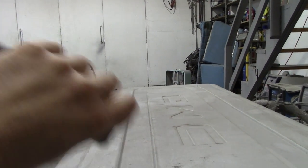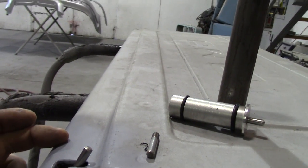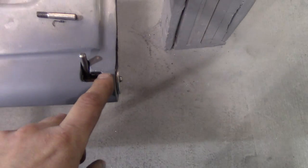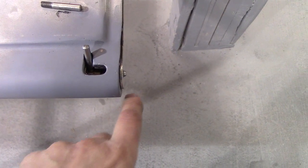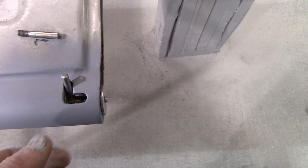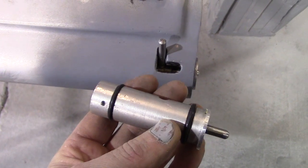What I've done here is welded a piece of tubing into the tailgate, welded all the way around. Before welding it in, I cut the tubing for the handle slot and also marked and cut the tailgate for the handle opening. Then you slide your tubing in, make sure your two holes line up, then weld your tubing in because there's no point in taking it out anymore. And that's it - once your tubing's in, Bob's your uncle. You slide this piece in and you're done.